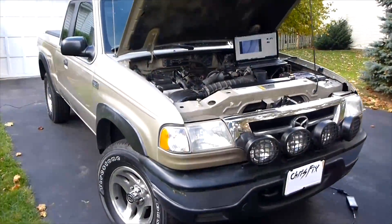My truck will be a good example of what a normal cylinder looks like. We're going to be going into the number 1 cylinder on the passenger side. The spark plug on this is not up and down like in a straight 4 — since this is a V6, the spark plug goes in at an angle, so we're going to get a half cylinder wall, half top of the piston look. You can see the cylinder wall has cross-hatching from the factory, which is pretty awesome for a truck that has 120,000 miles. That dark line at the top is the top of the stroke, and that line all the way at the top is where the head meets the block — that's where you would have a head gasket leak if you had one. But this engine is in tip-top shape.